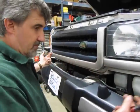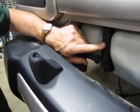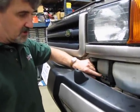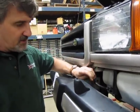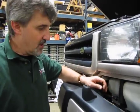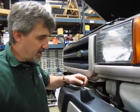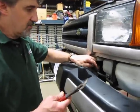We're able to pull the bumper away and lower it down. The last obstacle is that this vehicle is equipped with headlight washers, meaning there's a motor up front with a hose we've disconnected at both ends, but we also need to disconnect it from the motor. If you just disconnect it, you're going to lose all the fluid out of your tank, plus lose your windshield washers front and back. So we're going to clip this hose, insert an 8-millimeter bolt inside the hose, then clamp it — because a regular cap will blow right off if you accidentally hit the switch. Should you ever want to put the stock bumper back on, just remove the bolt and use a plastic union to rejoin the hose.